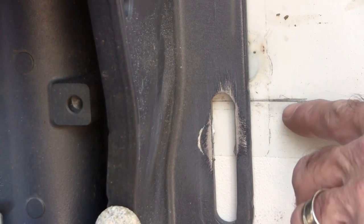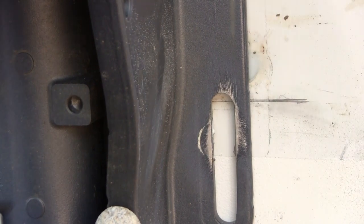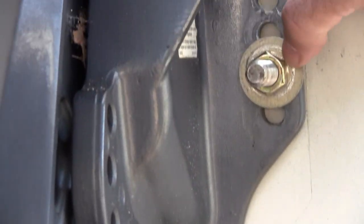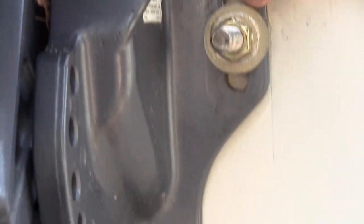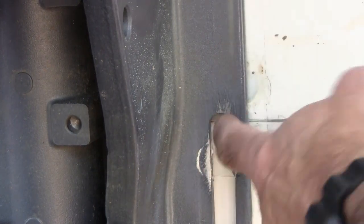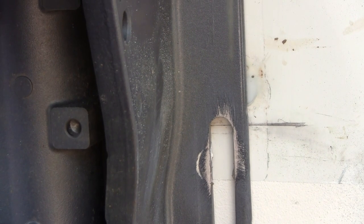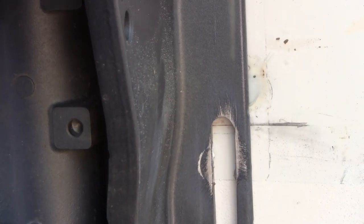I'm on the starboard side. Here's that line I drew as a reference — approximately six and a half inches below the top hole; the standard would be eight inches. I've got the engine mounted two holes up. Once we get the bottom bolt set, we'll be able to raise the engine another hole up but won't be able to go down. That's fine, because it's been proven on Continuous Wave that two holes up is the ideal height for the 17, 15s, and 13s as well.